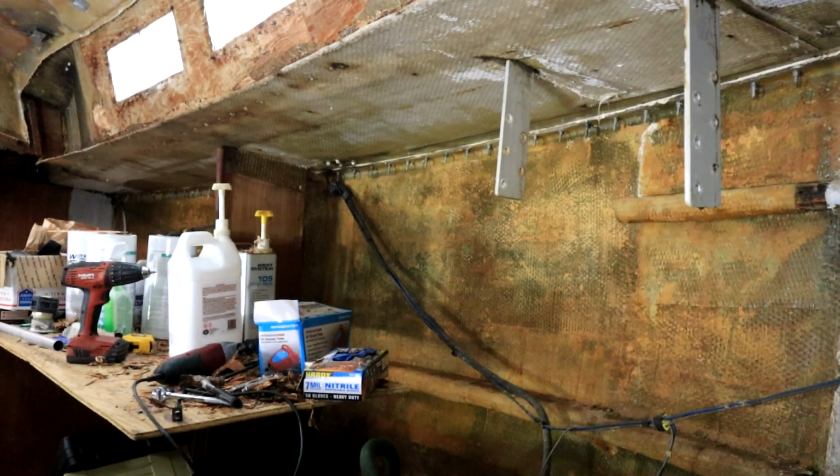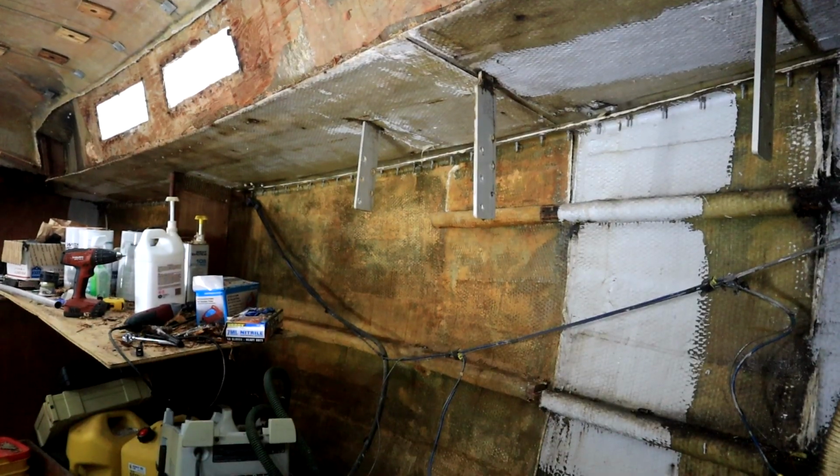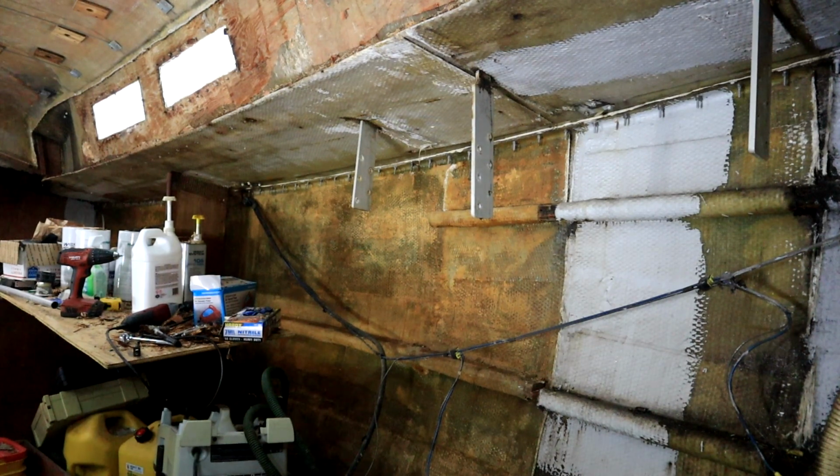Little bit of a struggle to get that jib sheet traveler removed. A couple of the bolts for the deck gave me some trouble. I was able to remove the base for the chain plates above the deck, the bottom of the turnbuckle, and a plate that gets sealed to the deck to try to prevent water from getting in around the chain plate. So the last thing to do is to pull these chain plates.